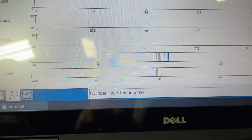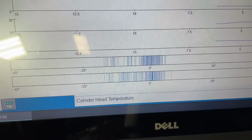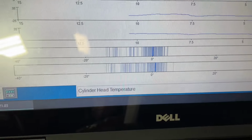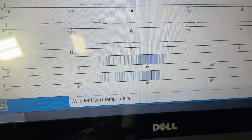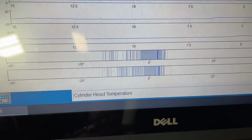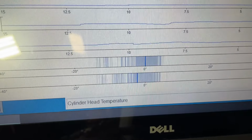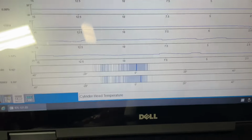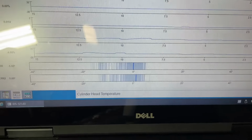And you can see they're not holding, see that? They're kind of all over the place. They're not being actuated anymore. They should come right back down to zero. And this gets worse as we heat up and the oil gets thinner. Now I already checked the oil level, and of course it's just fine. He's not due for an oil change for another 2,000 miles. And eventually as this heats up, it'll go way over here and be way out of range. So the VCTs and the oil flow are still a major issue in there.